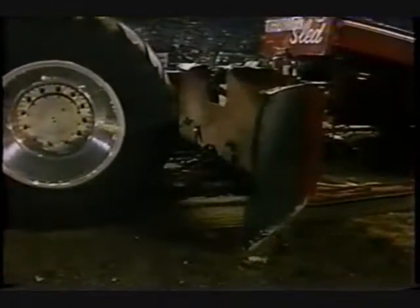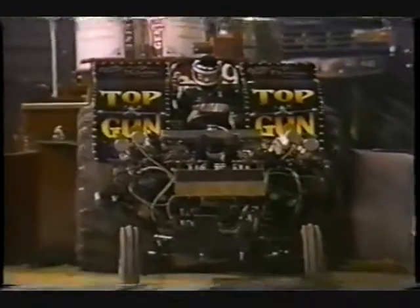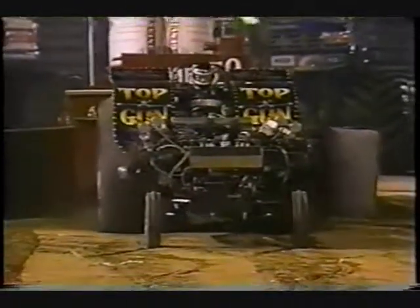You've got two engines there. Anybody who brings their car in to get it tuned knows that timing is a very important thing in everyday traffic. What about for this? The timing has got to be perfect on both. A lot of times the guys will set them so they're firing 90 degrees apart.